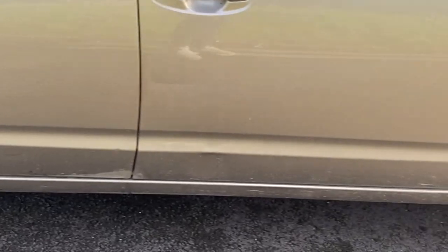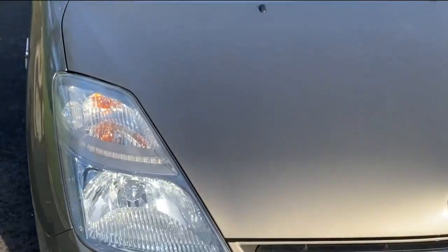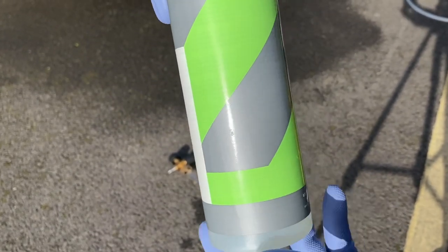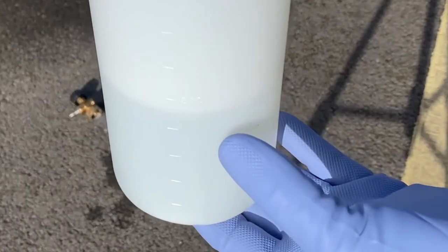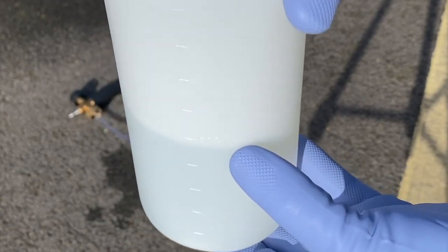Overall, the car is in a pretty dirty shape after a few snow and rainstorms. So let's get ready and hit it with the CarPro Lift. Lift is a highly concentrated pre-wash foaming agent that dissolves and lifts away a large amount of dirt and grime. The recommended dilution ratio is typically 1 to 10 — one part product to 10 parts water.